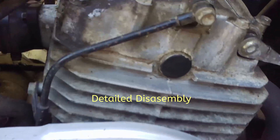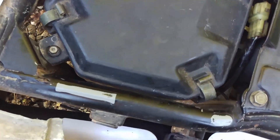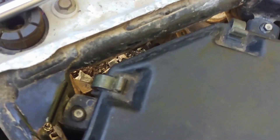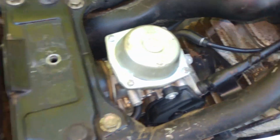In order to get to these two valve covers — the intake and exhaust — we're going to have to remove the gas tank, which I already have done. Take apart the air breather. Take these two bolts out here, these four bolts for the brace, and this plug. You're going to need to take out that Phillips for the snorkel attachment to the air breather. Then take apart the snorkel from right here at the top of this Phillips, and then you can get that snorkel out and get right to the top here.